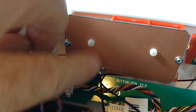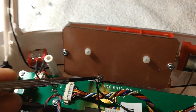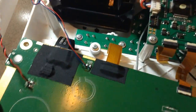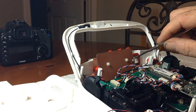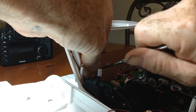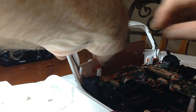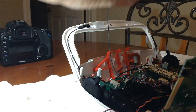This is the Wi-Fi patch antenna that's built in — it's on the front and it's soldered, with the solder connection visible right there. The wire is routed down beneath, underneath all the circuit boards, working its way back to where we just disconnected it from the Wi-Fi connection. Now we're going to take out these Phillips screws — two that hold the patch antenna onto the red bracket — and then take that red bracket off too. We don't need these anymore, but I'll put them in a bag to the side in case I want to restore it to factory condition later. Just gently reroute this wire out, pull the whole patch antenna out, and set it to the side.